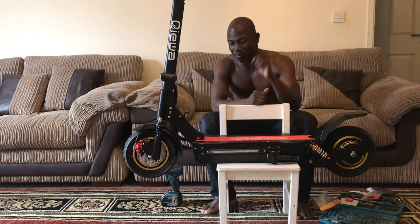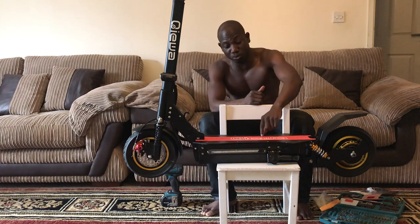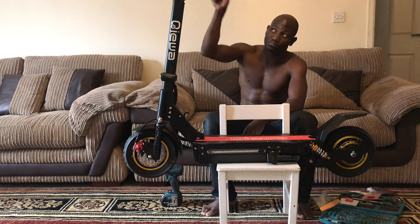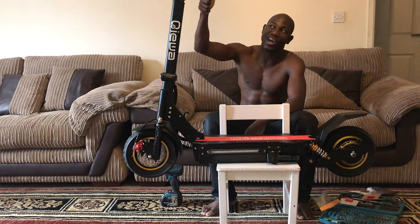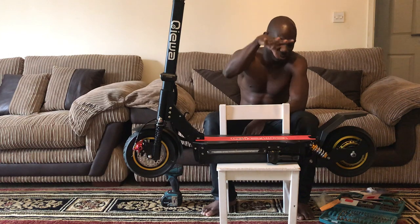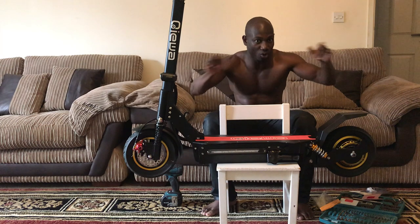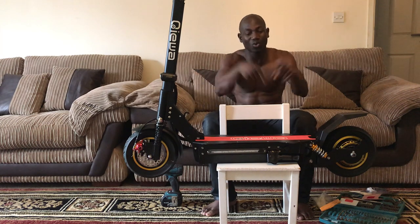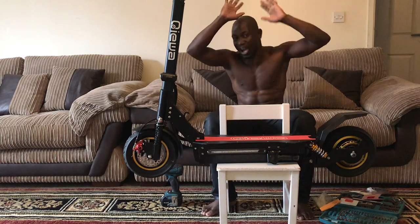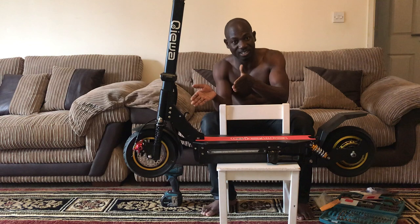And remember, before you put the top plate on to start screwing, when you put the silicone, go back and put your scooter on again and see if it's working. Because when you're putting the controller down, trying to do all that, you might mistakenly unplug some clip or something, you don't know. You don't want to do that and then come again, making a mess, taking the silicone out, putting it back. You're only going to make it not really watertight, you know what I'm saying?